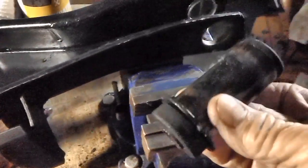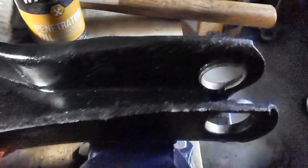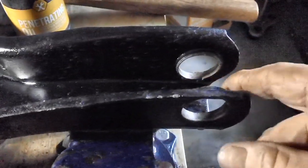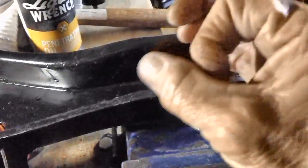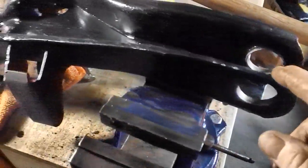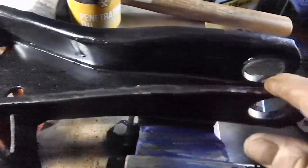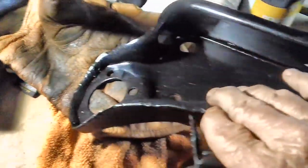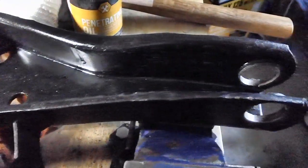And as expected, it did bend to my will — get that baby out of there. I'm going to have to clean this up a little bit. I've got to put a couple of grinding wheels — sanding tubes, whatever they call them — on the motor tool and kind of smooth down a few edges here. There's some really sharp stuff here that I could cut my hand on, and you want to be careful of that. I'll spend maybe 10 to 15 minutes going over it top and bottom, then we'll go ahead and repaint the whole thing and make it look good.